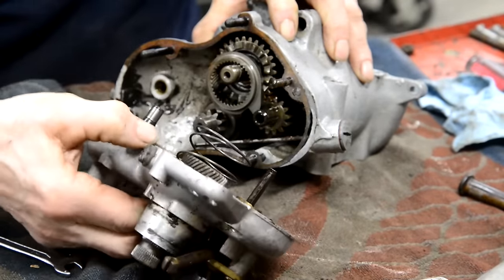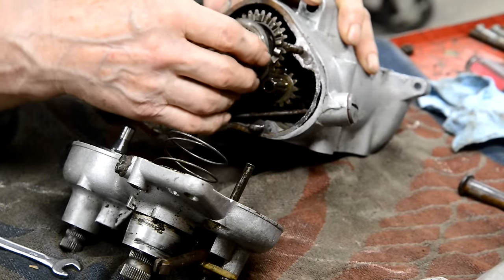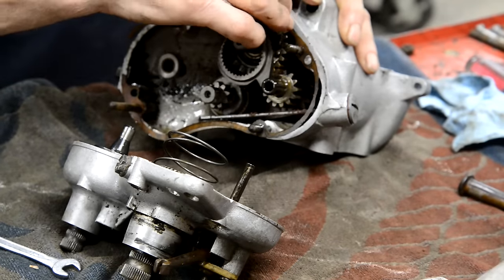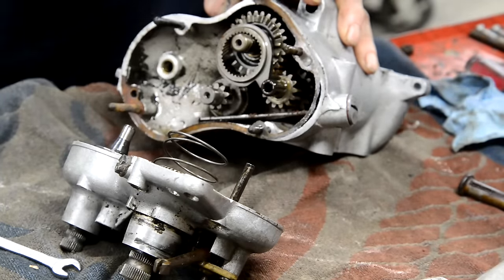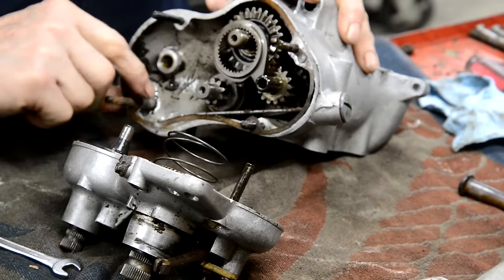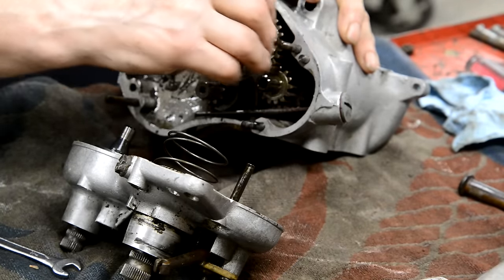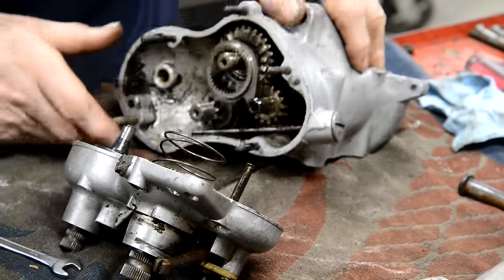Springs and all sorts of things in here, look. Got dipstick even. And a gasket. I've started making a list of engine spares. I checked on the Villiers website last night. They go up to 80 thou over on the piston, so we'll be all right. I seem to have everything I needed as well. So the only thing that's holding me up is knowing how big a piston I want, because I don't want to order everything and then have to order a piston, because obviously one of the big things with getting stuff from the UK is shipping.